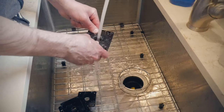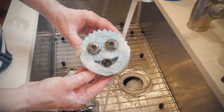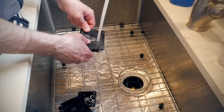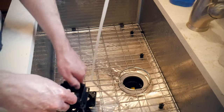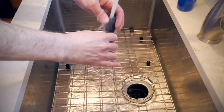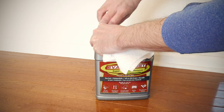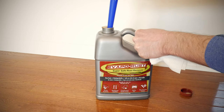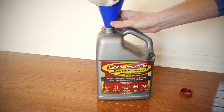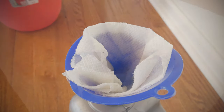The rest of this stuff just needs to get scrubbed and cleaned — regular dish soap with another cameo by Scrub Daddy here. This stuff is never going to be perfect, but at least you know the loose sediment and most of the grime is off of it. Some pieces will retain the rust stains, but at least you know they're clean. Now that the parts have soaked overnight, you just pull and rinse them with water. The cool thing about Evapo-Rust is that it's reusable to a degree — I dump it back into its container using a funnel with a paper towel to help filter out the rust bits and sediment.